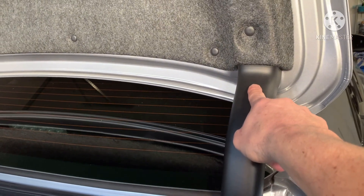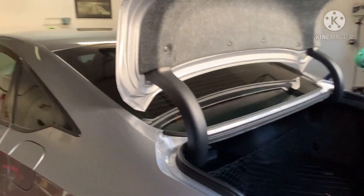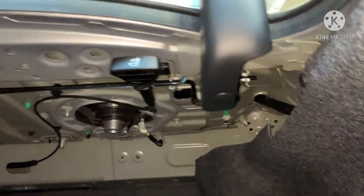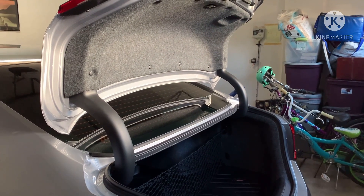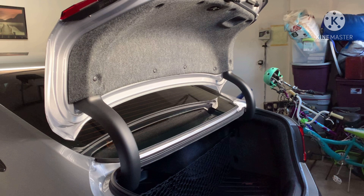I'd highly recommend this if you have a power tool and you're not afraid to drill into the car - very easy to do. There's already a hole in the trunk arms from the factory anyway, so you're not going to hurt anything. Just be careful when you do it so you don't slip and crack your window while drilling - until the drill bites, if you slip it can easily hit that back windshield. So be very careful. If you want to go this route you can - the other way works fine too, it just depends on your skill level. Overall easy, took me about 25 minutes. Just wanted to give you guys another option for these trunk arm garnishes. If you haven't, please hit that like and subscribe button - hope everyone's staying safe out there, catch you on the next one.